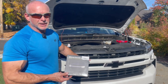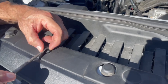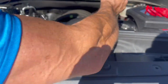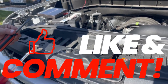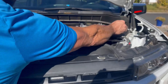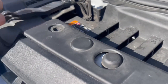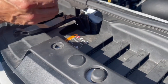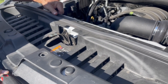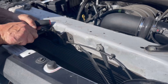First step: you have ten of these pop-ups to get out. I usually start with a screwdriver just to get it going, and then you can use a trim removal tool. There are tools specifically for this — I just found getting into the slots easier with a screwdriver initially. Keep those where you won't lose them. Then T15 for your hood latch — some guys say don't take it off and just manipulate it, but I think you'll end up breaking it. Take those off, then just pull the intake tray off and put it to the side.